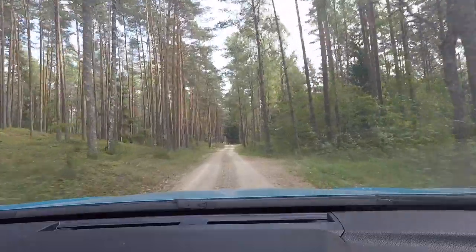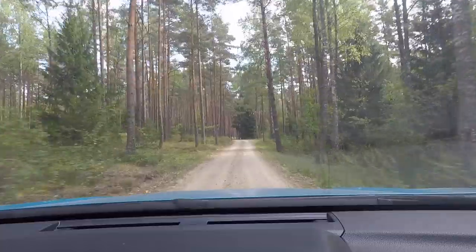We did a bit of off-road driving earlier for Michael's segment for Planet Auto. At this moment I am actually in pure EV mode. It's not a full self-charging EV like a Toyota Prius, and it's not a plug-in hybrid like a Mitsubishi Outlander PHEV — the electric-only range is only one or two miles. But it kicks in when it can, and now the engine's kicked in. Throttle response is very sensitive — it actually comes down to the degree of input you put into the accelerator. If you put around 10% throttle, or about 10 degrees input, it will stay in EV mode.